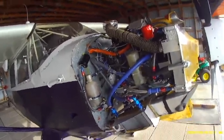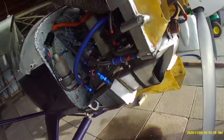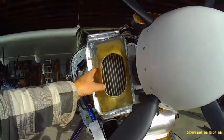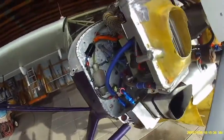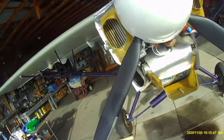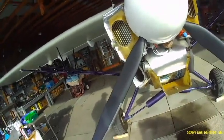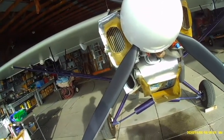One of the main problems I've had is trying to get both oil and water temperatures within an acceptable range. When I first got this airplane hooked up I got one oil cooler — it wasn't enough, so I got a second one, and now it's almost too much — kind of overkill. I've always had pretty good oil cooling, but I've had a heck of a time getting the water jacket temperature under control. The main reason is I simply don't have the airspeed in my favor — 80 mph climb-out and cruising at 100 mph is just not the same as climbing at 100 and cruising at 150.